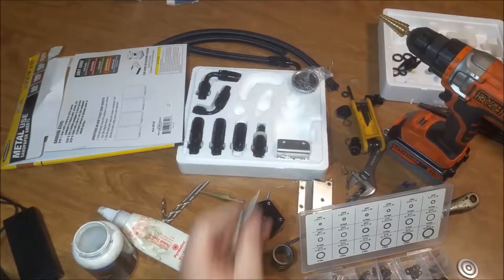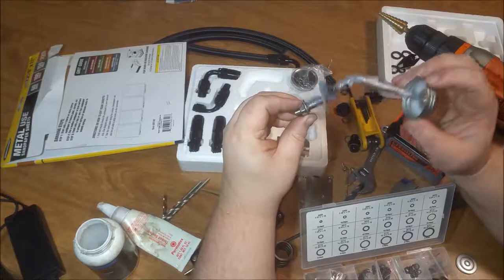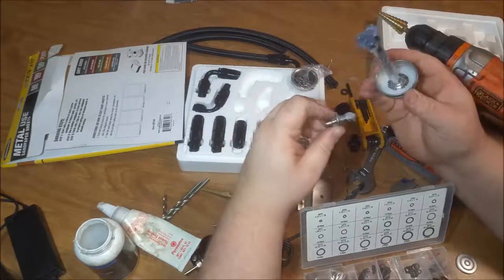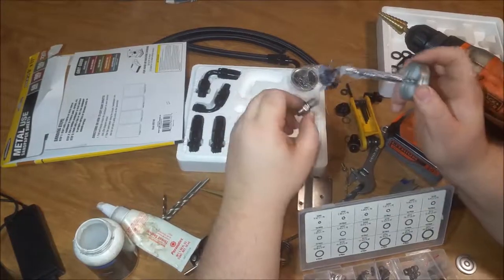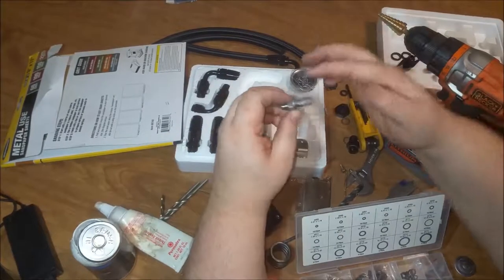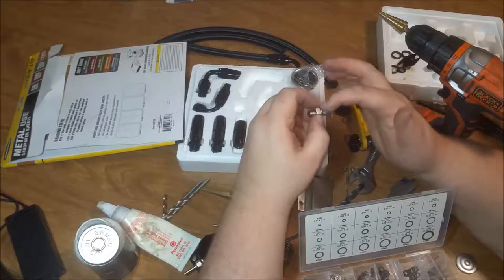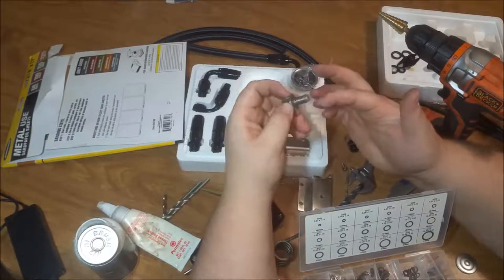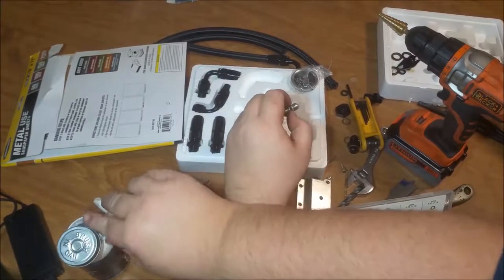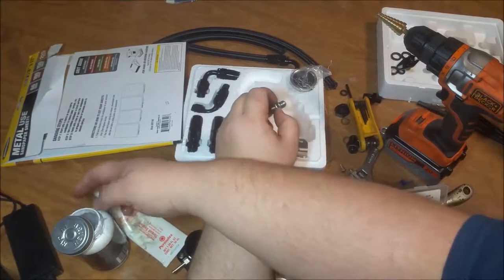So here's what I'm going to do. We're going to use this lubricant. Okay, we're going to be liberal with it. Because this is the vacuum side, I guess pressure side too, of this thing. We don't want it leaking here, because that would mean our fuel pressures would be off. You'd have another leak spot under boost. It would leak out at boost.